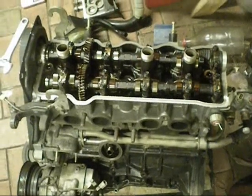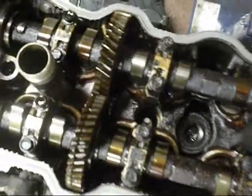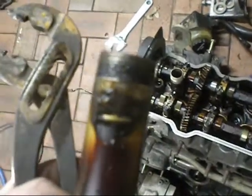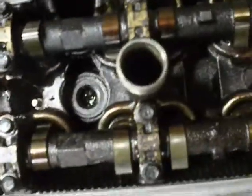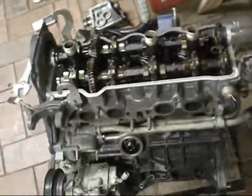I'll pop the lid off the newer engine. Yeah, it looks old, but not very tired, you know. The cam still looks good and everything. Noticed a tiny bit of oil in the spark plug hole, so I screwed the tube out. Just put a bit of Ultra Blue or something on the end there. Probably Ultra Black or high temp sealant. You can't really get seals for these. That's easily done. Do all this now before I put it in the engine.